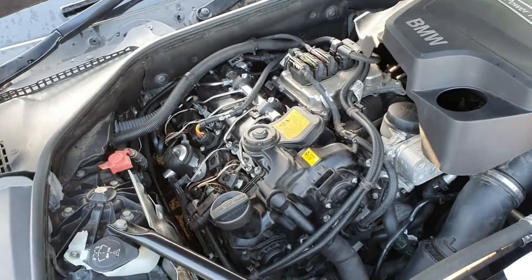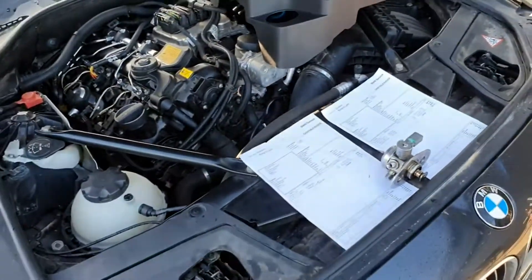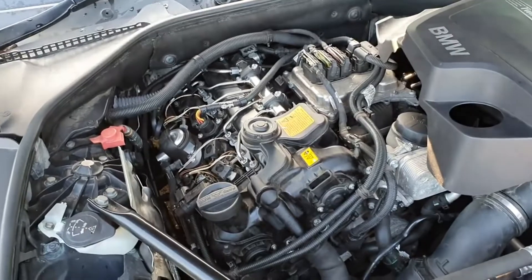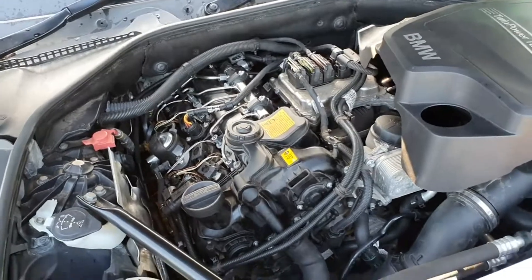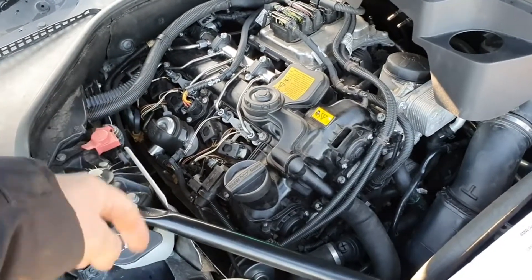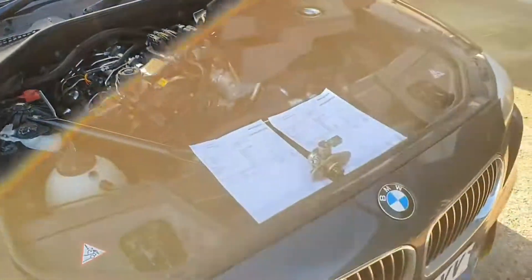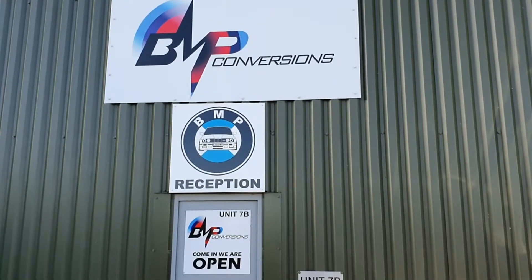It's a normal, straightforward job — not difficult at all — but be aware you're going to have to spend a lot of money replacing the fuel system right back to the rubber hose. Don't force the cover up because it's under the vac pump — remove the vac pump first. Do the spark plugs while you're there so you never have to interfere with this side of the engine again. Labor involved is about three to four hours by the time you've got everything off, put everything back on, and cleared any fault codes. Also, every time you open the fuel system it squirts petrol out, so put a bit of tissue down to catch the fuel. Hopefully that helped — give us a thumbs up, subscribe, and the next video is coming soon.